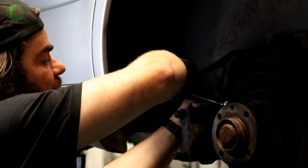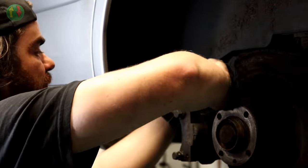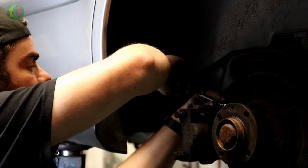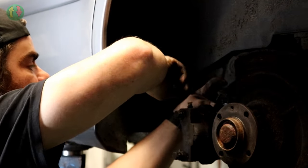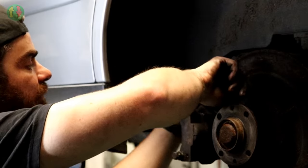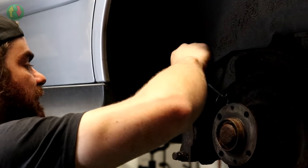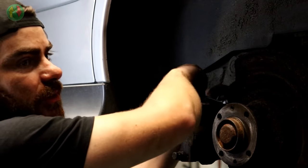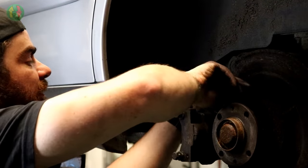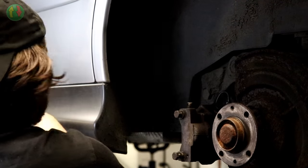Ow! It will start to leak a little bit. It's coming undone properly. It's not seized or anything, which is good. Get some of this cleaned or I'm running out of oil again. Go through a lot of that. And if this was a brand new system, you'd be able to do this by hand by now. Be finger tight. But if you've got a really rusty pipe, I mean, this pipe's in good condition because it's got a coating on it, but if you had a really rusty pipe, you wouldn't just try doing this. You'd get a wire brush on the pipe first, because if you start undoing that union and there's rust on the pipe, it will bind up and you'll have all sorts of unpleasantness. There we go. Right, so that's coming out and that is leaking already.